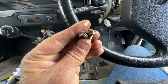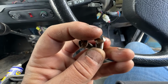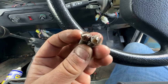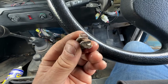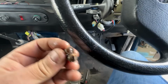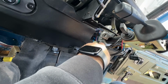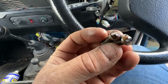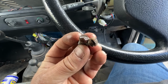Okay, there's a good chance that these are the original bolts because you can just see where the breakaway piece at the top has broken off. Now someone's gone in there and put some very nice little slots so we can undo it, which I guess is possibly a solution for you guys if you're going to have to take yours out and it's not been messed about with. So just get a little bit of access by cutting around the lug, getting access into there, and then looks like they've just used a cutting disc or something just to put some slots in there to undo them. But hopefully we've got new breakaway bolts with our new kit.